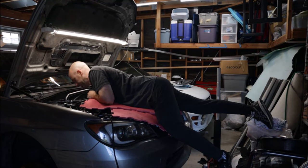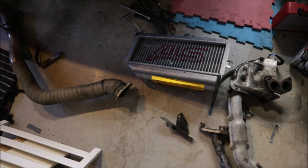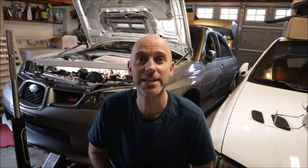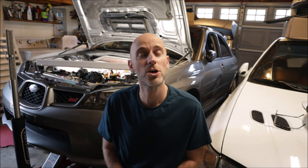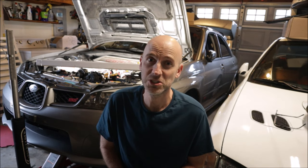This is not comfortable. I now realize that my methods to change this one hose may be flawed. This is my 2006 Subaru Impreza WRX STI that I recently purchased with 140,000 miles and some severely neglected maintenance. Today we're going to try to save some money — $330 is what the shop wanted to fix the valve cover gaskets, and I'm going to try to do it myself. The oil cooler O-ring is also leaking, the turbo return line is leaking, and probably many other oil feed and return lines are leaking. We're going to start on the valve cover gaskets and see how far we get.